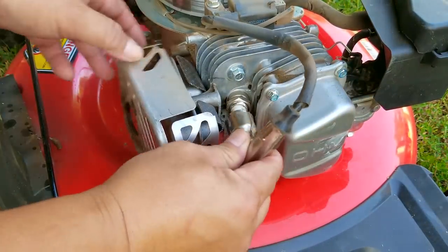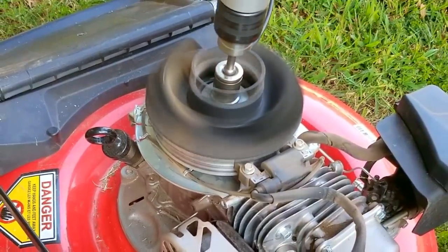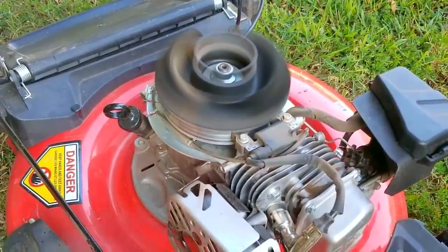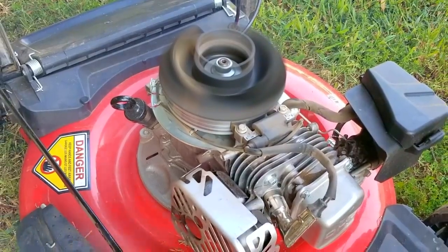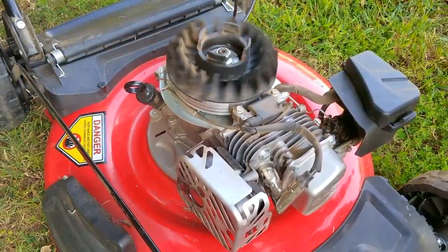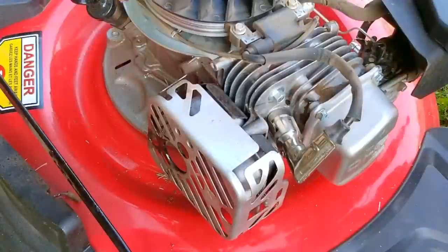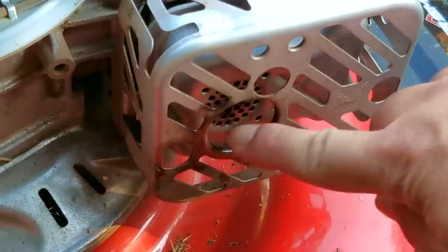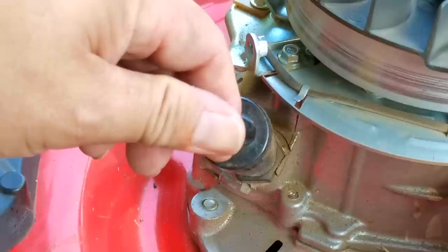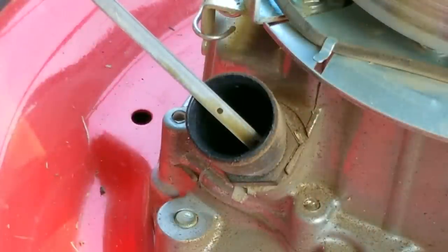This time I'm going to cheat and use the drill to help get it started. That's not how I expected the test to go — it took a lot of turning before it started to run, it was very slow to start, and it ran a lot longer than it should have, so I wonder if the carb was supplying some fuel. There's also oil coming out of the muffler, so I have to wonder how much oil is in the engine and what condition it's in. I think it'd be a good idea to inspect the oil.